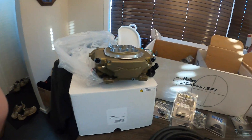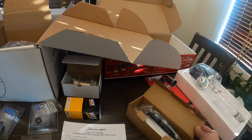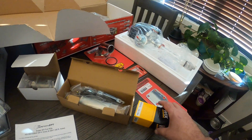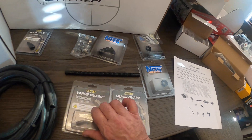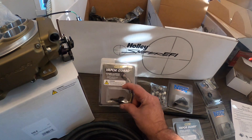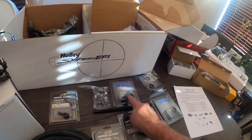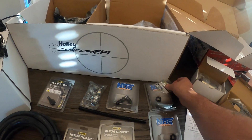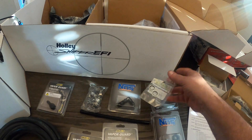With the complete master kit, you get some extra stuff as well. You get more wiring — it's always wiring with these things. You get your inline fuel pump, and then you get two filters: one is pre-pump and one is post-pump. You also get these fittings — people always say they're random, but they're not. Two of them come off of the unit itself, and this one comes off of the bung in the fuel tank. You need a bung in the fuel tank for the return line. We'll come off the existing line, but we need a return, and this 90-degree fitting goes back into the tank.